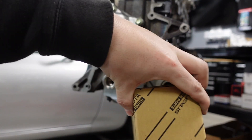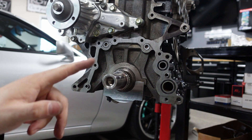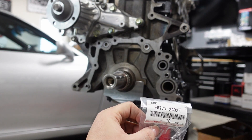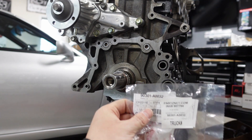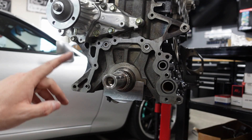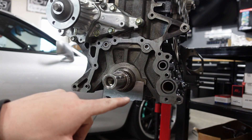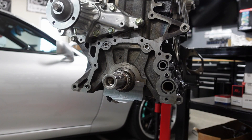Here's the part number for the oil pump if you guys need it. For the o-rings, you'll need two part numbers — the small top one right there, and the one below it here. Once you've got those, you also need to apply FIPG when installing the oil pump. Before you do that, make sure you clean off the mating surface — if it's got oil or grease on it, clean all that off so the sealant actually adheres properly. Same thing with the oil pump itself.